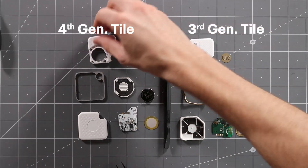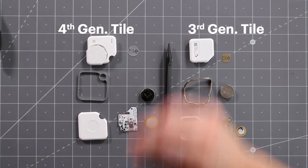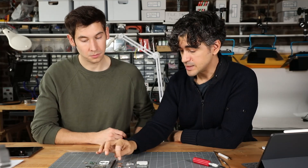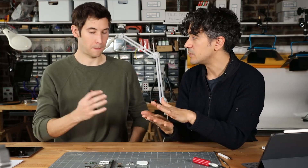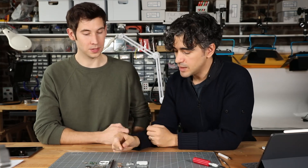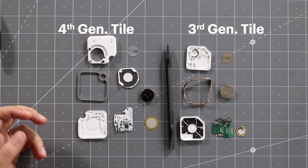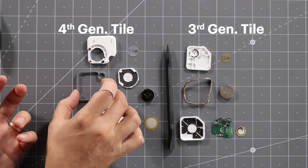What that means is that the backside of the product when it's closed — the new one is a little bit calmer. The only marking on there is the machine code, whereas on the old one they had to include all the information there. The architecture is very similar — they're still doing the same contacts, spring-loaded contacts to make an interface with the speaker. They're reaching a certain DFM and supply chain maturity. The battery supplier is the same, the decoration technique is the same. They're doing a welded sandwich around a metal frame.